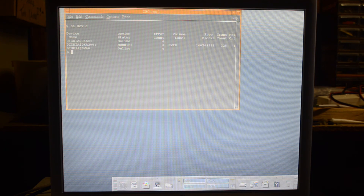We've now booted off DKA200 successfully — a 72 gigabyte drive, Ultra 320 and 15K RPM, so a bit of a high-performance drive running on our Alpha. Of course it's only running in SCSI 2 compatibility mode, but at least it's got a lot of capacity and it's running at high speed at 15K, which is an advantage over the old RZ28 that I had in there.